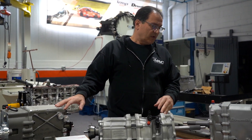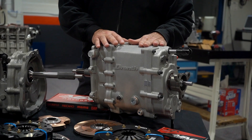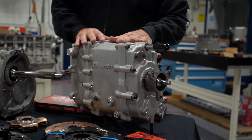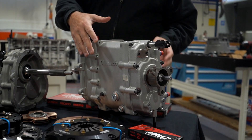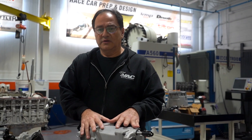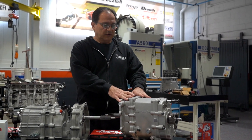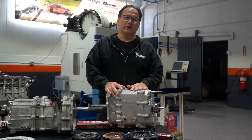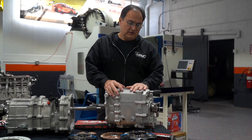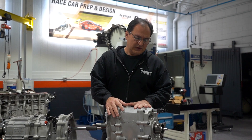There's a DG350 we're not displaying. Over here is an H-pattern gearbox. With these castings, this is designed to be the Getrag 265 replacement for the E30 M3. They've gone on to make their own castings since those OE cases are very difficult to come by these days. The gear kit is actually designed to fit in the original Getrag transmission, but it's got to be the dog-type version. Those are pretty pricey, so Drenth figured — availability issue, price issue — we'll do our own castings.